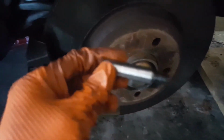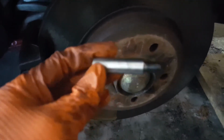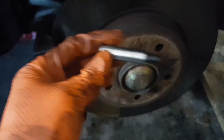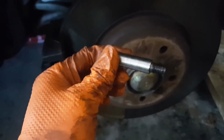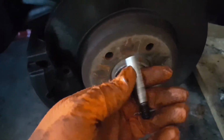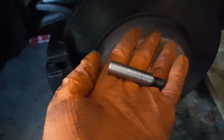This kind of grease or polish compound to smooth out the surface. It's very important to have a very smooth surface because it is for sliding purpose. So it has to be able to slide very easily. You cannot just sand with 200, otherwise it will be too coarse and cannot slide easily. So typically for BMW per se, this slider pin will not rust. My car is about close to 20 years now, so it will not rust.